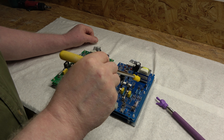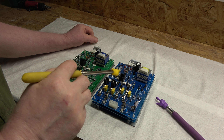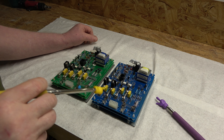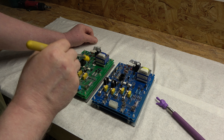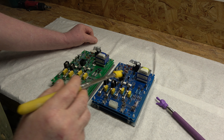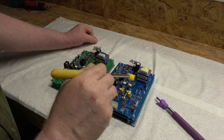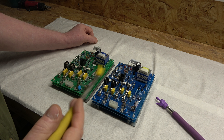This was listed as unbranded, but I found this exact board on Amazon — I'll post the link in the description. The only problem this board had was the igniter would not turn off; all other functions work perfectly. We'll install this and see if it does the same. On Amazon they list this as an upgraded program for your stove to work at peak performance, so there might be some differences.